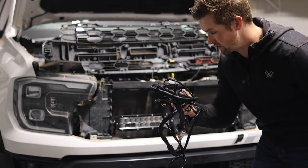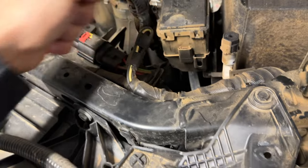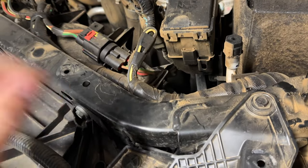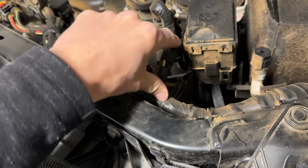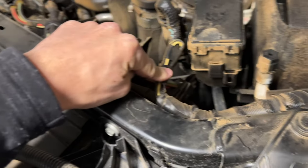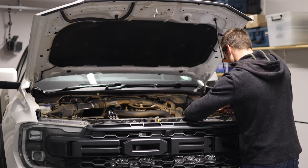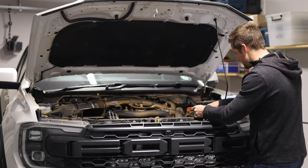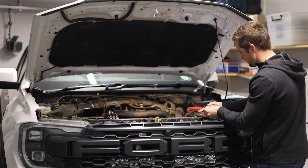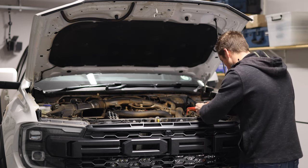This is the home stretch. What we need to do now is get this wire out here, so I'm going to cut that electrical tape. It's basically pre-wired into the car. We're going to cut that electrical tape there and then open this up so we can add a little terminal on that wire. Now we need to cut off this heat shrink that is already on there and free up about a centimeter worth of wire. They've really gone all out on that heat shrink.